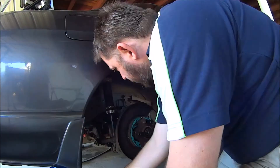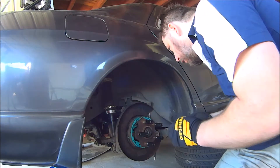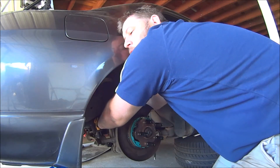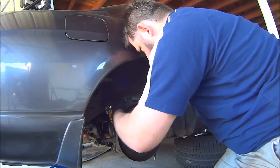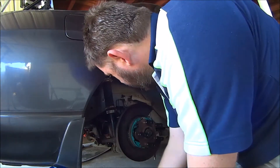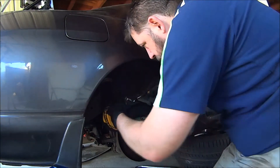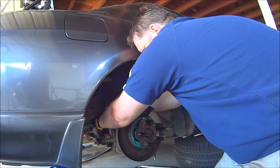I'm going to put that in first — the camber washer with the odd shape. Make sure I put it on the right way. That's the camber washer on, and the nut. Let's do them up finger tight — that should give you the movement and slack to get this in there. Voila. Making sure that the camber bolt's in the right place. Get a little bit of tension on it.